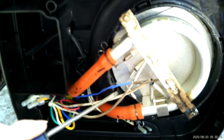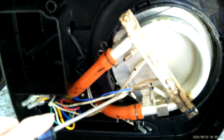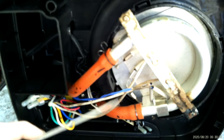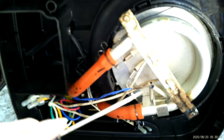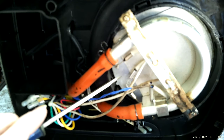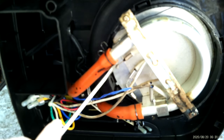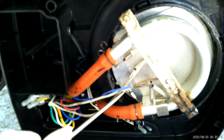This is heat-wrapped wiring — it can stand all that heat, though it's a little scorched from getting hot. There's a circuit board down there. I watched a couple of videos. Somebody was saying you can repair these by wrapping the fuse's long tails around the connectors, because these are spot welded. Unless you've got a spot welder and know how to use it, you can't spot weld them. I fiddled around from this morning until after I ate lunch at 3:30.